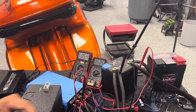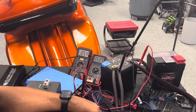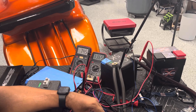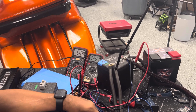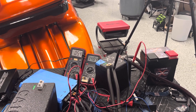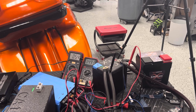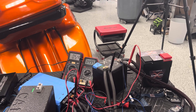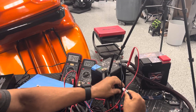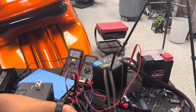That was 7,000 watts in that test. We're going to hit it with 5,000 watts one more time - not that I'm worried about the amplifier or the battery, I'm worried about the woofers. The guys over at Concrete Audio were correct: the higher you charge this battery, the more you can get out of it. Resting at just under 15 volts - 14.9 - it's going to hit 15. Even with the amp connected, it'll hit 15 volts.